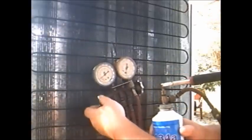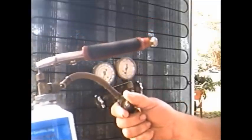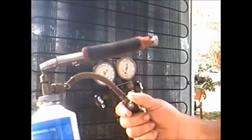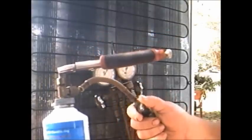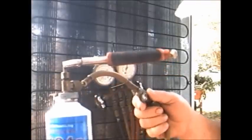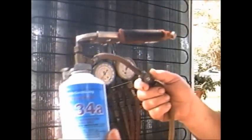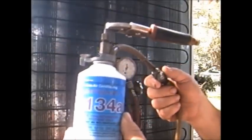What I'm doing is I'm turning this little release valve right here, because I don't want to add this in too fast — that is the key. You don't want it choking down, it's just as bad as if it ain't got any in. I'm feeling the can; it's cold to the touch, which means there's gas flowing out of it.